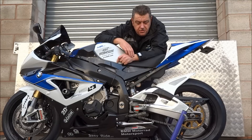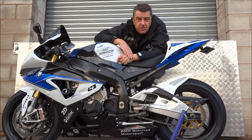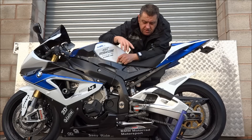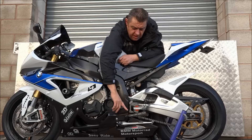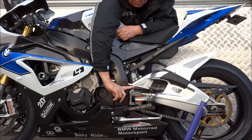Hello, I'm Roy Tansley from ProShift. I'd like to give you a brief demonstration of this gear shifting system which we call the digital closed loop bump and blip. It gives you flat upshifts, but because it's closed loop every gear shift is as short as humanly possible, because the system uses this linear potentiometer down here to measure gear lever position at all times.